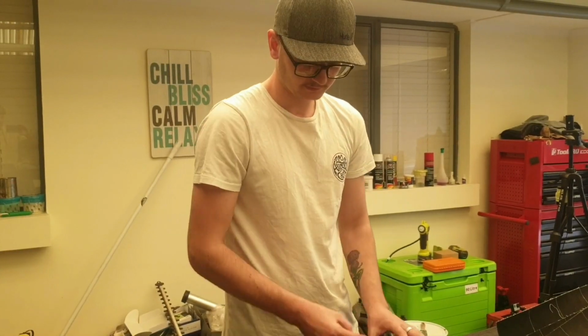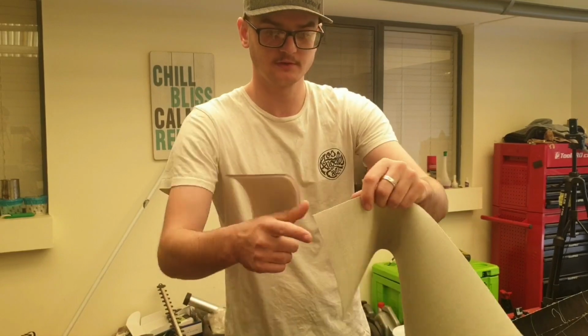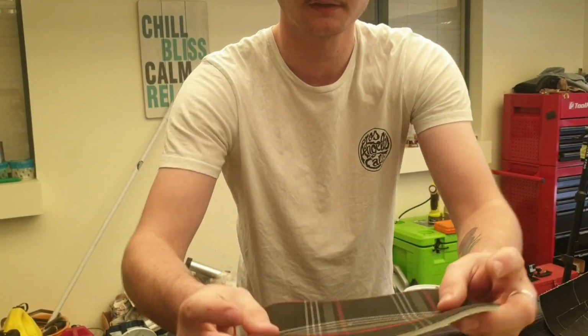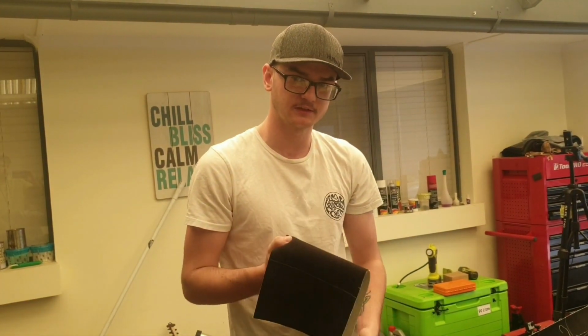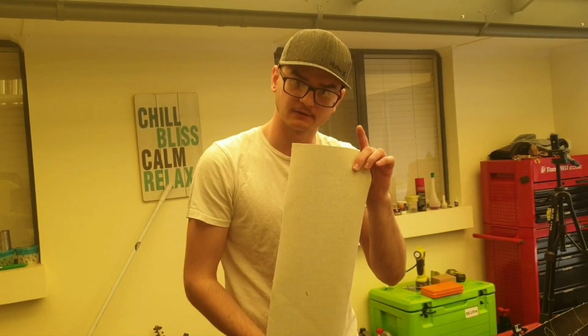Alcantara. That tickles my fancy. The next part, I want to get this Alcantara here to be as thick as my cloth. You can see, the thickness of this is very, very thin compared to this cloth, which is quite thick. This has got a spongy backing on it. That's just to make it feel a bit nicer and add a bit of durability. So I'll be doing the same with my Alcantara just to get it to feel the same. And when I stitch it together, you can't see a huge transition from the backing to the non-backing stuff.